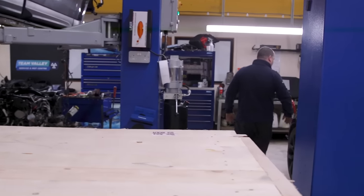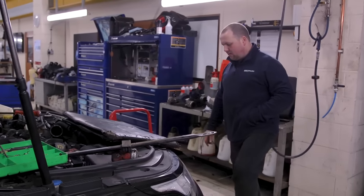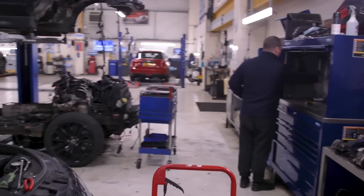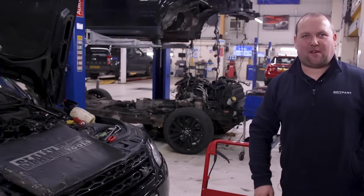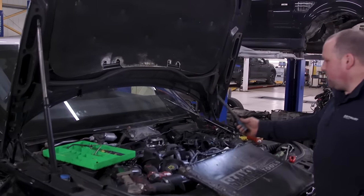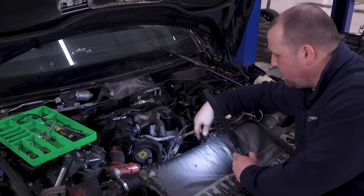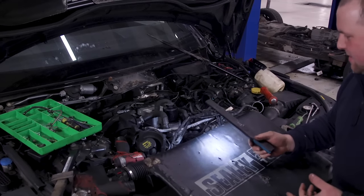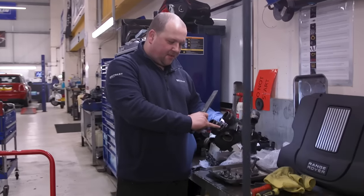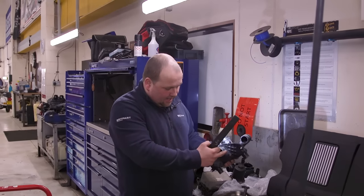Last job of the day is this TDV8. I wouldn't say quite rare, but it's definitely the better spec of the Range Rover Sport — the TDV8. We've done a very similar job on a Discovery 3 which was the oil cooler. You can see the top of the motor's all stripped down. In the course of that job we always replace the thermostat housing as well, which is this here. Pretty common — that pipe there was just starting to crack, a little sign of a weep. When we touched it, it just snapped off. You can see a little leak around that bottom O-ring, and also the top has a really fragile little pipe — that one there is snapped off. So that would normally sit in there like that, and that pipe goes there. But every time you touch these, because it's had hot coolant running through it all day going hot and cold — and that car is probably a 2014 plate — as soon as you touch it, it snaps.